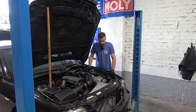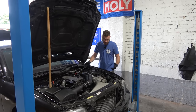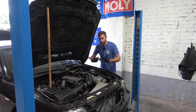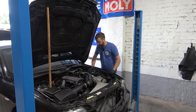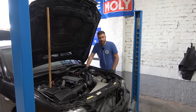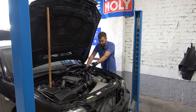There are two components that I used from the donor engine that could cause this: the VANOS solenoids and VANOS units - camshaft adjusters. I used them from the donor engine because they looked very clean, much cleaner than the old components. The previous engine before it blew up was running absolutely fine with no codes, and everything is the same apart from those two components. So I'm going to start by replacing the VANOS solenoids, which means I have to take the stupid supercharger out again. If that doesn't help, I'll remove the valve cover on bank 2 and physically check the timing.